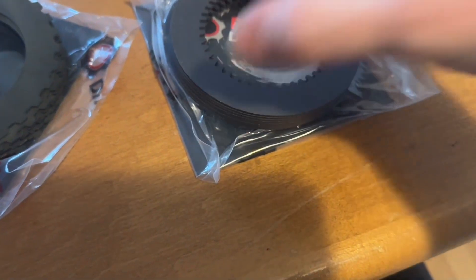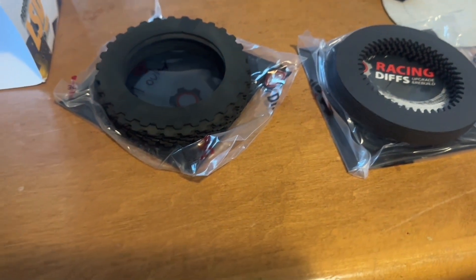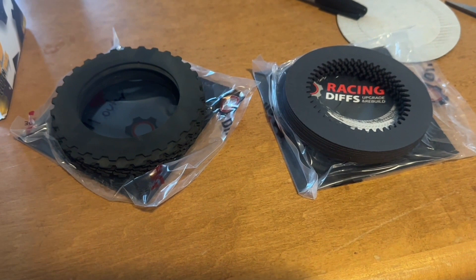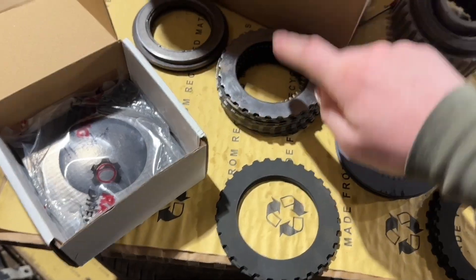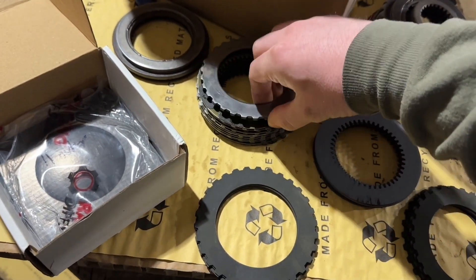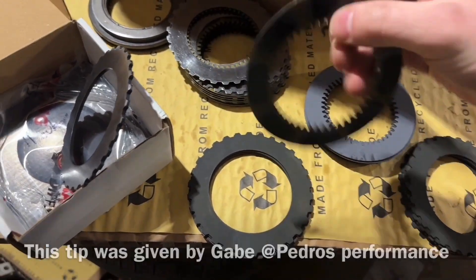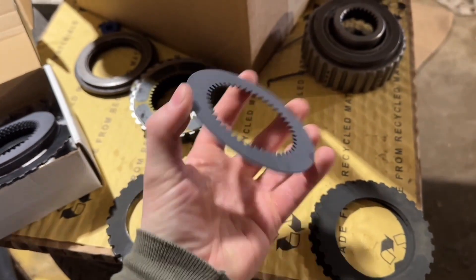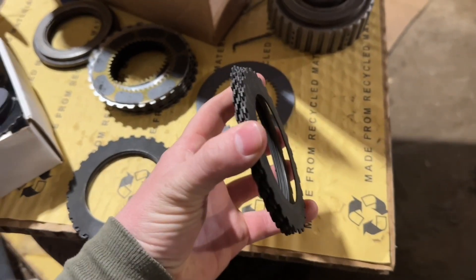What tripped me up in the beginning is this kit didn't come with any real directions. The flat plates here come in two different sizes — thicker ones and thinner ones. Even though the friction discs are made of a better material, they're still thinner than the stock ones. This right here is the stock set of clutches. The stock setup has very thick plates on the farthest inner and farthest outer sides — we're going to need to save these to reuse them. There are friction discs in the middle and thin plates in the middle as well.